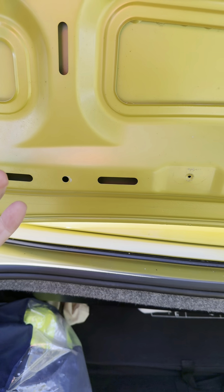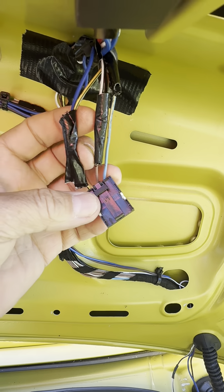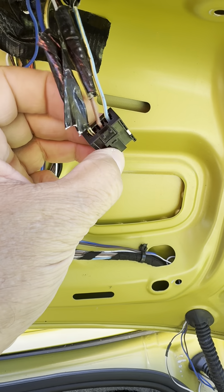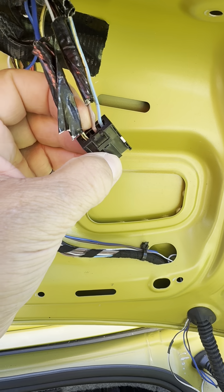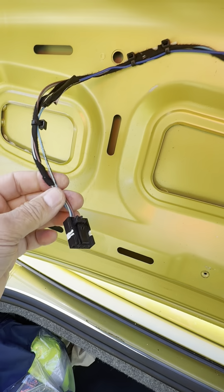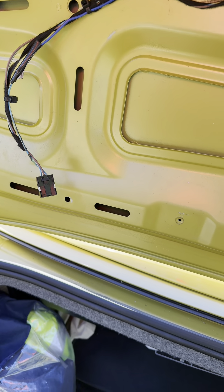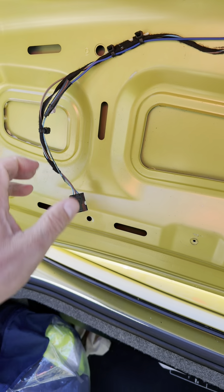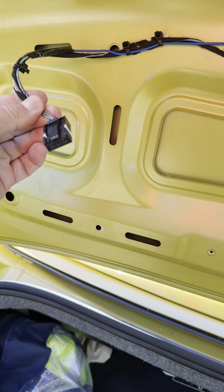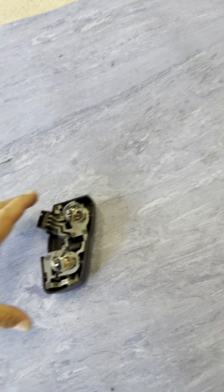All you've got to do to get the light to work is put the unit in place, get one of these connectors, put that in place, and it wires into the other one. I've just tapped into there - you figure out which is the reverse light and which is the fog light and just tap into them. When I bought it I got the connector with it and a bit of cable. I think the connectors might already be in place on your car, but I had a spare one anyway.